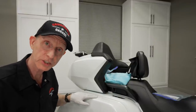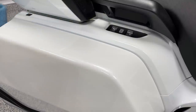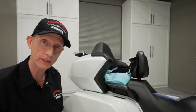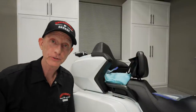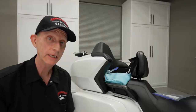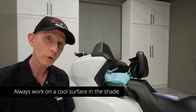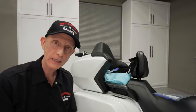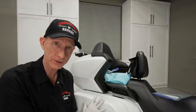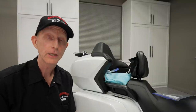If I think there's dust on the paint, I'm going to very lightly wipe it off — I'm not going to rub real hard because I don't want to risk scratching the paint with that dust. So I'm just lightly removing whatever's there, and then it will polish up really nice. This Speed Shine really does come off well — it comes off clean, and it also smells great. You'll notice immediately your paint will have a slicker surface because it does have ingredients to give it some slickness and protect the paint. It's not going to last like a wax job or a ceramic coating — it's not designed for long-term lasting properties — but as a quick detailer, it really is absolutely amazing. One other thing I would recommend: anytime you're using a quick detailing product or doing a clay bar treatment, you should always be working in a shaded area. I'm in my garage right now, it's only about 65 degrees. You just don't want to work on any painted surface out in the direct sunlight or on a really hot surface — these products are designed to be used within a certain temperature range, otherwise you could get some undesirable effects.